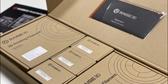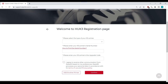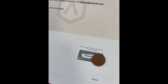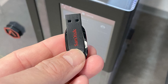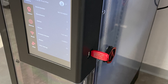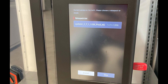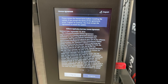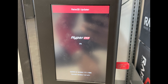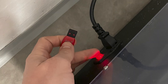First, the firmware. This is where that letter comes into play. Open it up and follow the link that is written on it. This will bring you to a webpage where you need to enter a code, which you can find after scratching the silver surface on that letter free with a coin or something similar. Enter the code on the website to get access to a firmware download file. Copy this file to a USB stick and go to your printer. Plug the USB stick into your printer and then use the power switch on the back to force a restart. The printer will automatically ask you whether you want to update its firmware. Click the install button and confirm the pop-up dialog. Accept the license agreement and the update will start. The printer will update both its motion controller board and its touchscreen firmware. After it has finished, remove the USB stick and force another restart using the power switch.